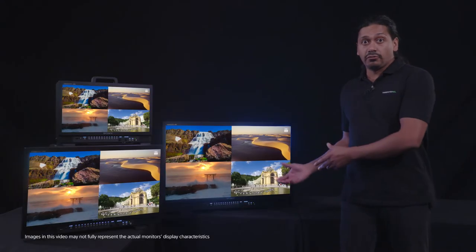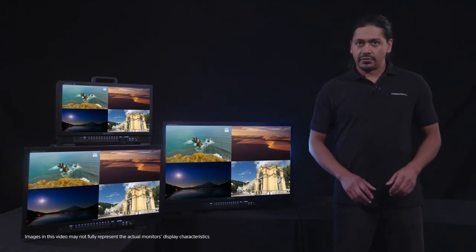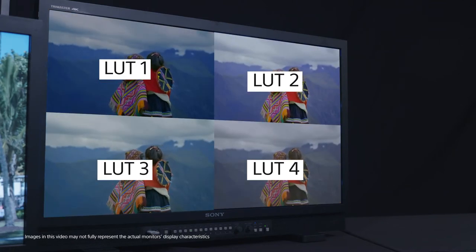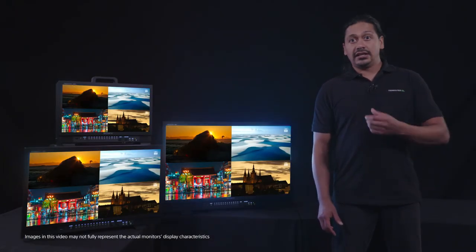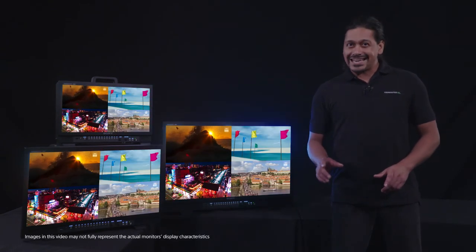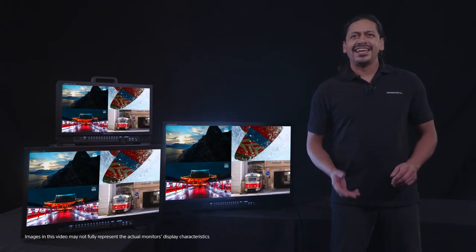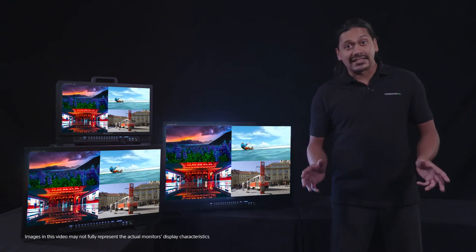Here you can see four different feeds on the monitor, but quad view mode also goes beyond simple multi-viewing. Each of the incoming signals can also be assigned its own LUT, making quad view mode ideal for comparing content. It's really easy to do this since all you have to do is assign a LUT in each of the four channel setting menus. Do note, even if we are feeding the same content to the different quadrants, each one of the corresponding inputs has to have a separate feed. It's tempting to think that you can use a single feed and loop it through the other connectors, but that's not going to work.